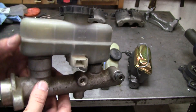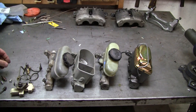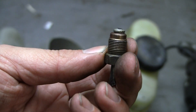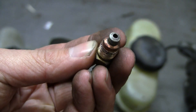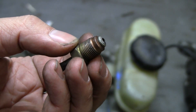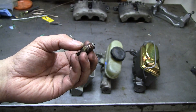I'm going to show you a metric bubble flare in case you've never seen one. This is a metric bubble flare — the threads here are metric, and you can see how the brake line kind of bubbles up; that's a bubble flare. This particular type of threads and flare are going to work in any Mustang master cylinder starting in 1987.